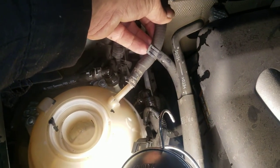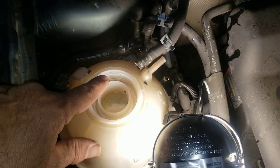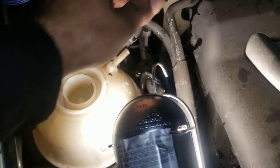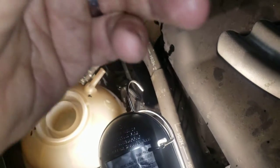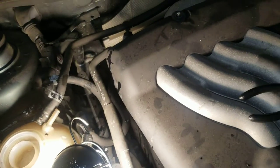What I found out was this hose right here — the hose to the reservoir — was blocked up. Look at this debris, tons of debris came out. I blew through it and tons of stuff went down there, all gumped up. It looks like gasket material — somebody put a gasket in there and gumped up everything.